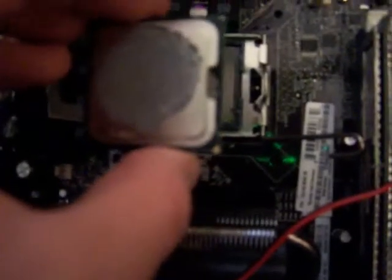If you look down at your computer, there is the CPU socket and you need to open it up — it depends on which one you have. As you can see here, there's a little notch on the right-hand side, and you need to make sure that both notches are aligned before you place the processor in.